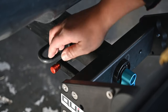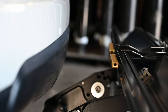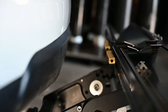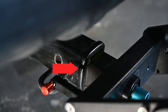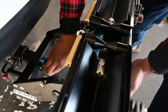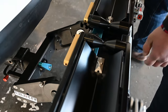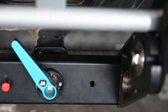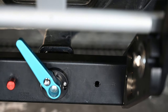Installing the Mach 2 on your car is really straightforward. Just insert the rack into the receiver, pull out the captive safety pin, releasing after it clears the flange. If the pre-drilled hole in your receiver is deep enough that your rack contacts the vehicle when folded, it is not a requirement for the pin to be in the receiver hole for safe use, as long as the receiver has a flange. Tighten the blue lever in a clockwise motion until tight, again ensuring it is in the top 180 degrees. It is also important during this step to wiggle the rack up and down to ensure a snug fit. When the lever is fully tightened, it is normal to see a very slight tilt of the rack in the receiver, maybe one degree. This is a sign of the expanding pads providing proper tension inside the receiver — it is normal for proper installation. Press the lock and you're done.